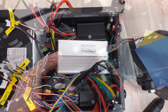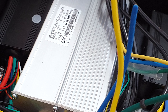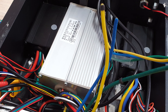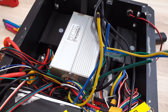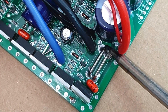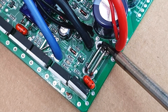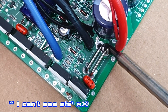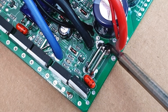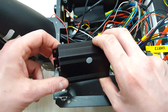If you are using stock controllers, which we can usually find in e-scooters at around 45 amps, then you don't need to do this kind of mod, because those controllers are like 4 times bigger than these and they don't run as hot. Also, if you'd like to do a shunt mod for that kind of controller, links are in the description — you can easily increase the power of a stock controller by up to 2 times by adding a little bit of solder on one spot.